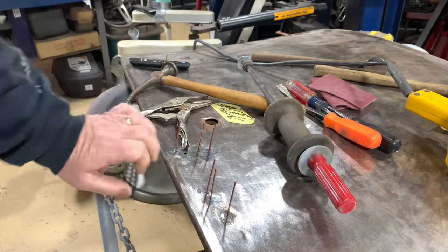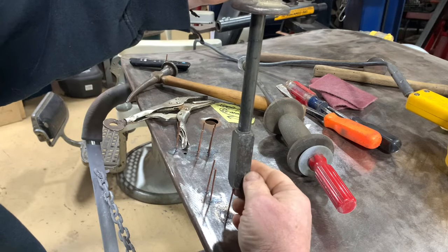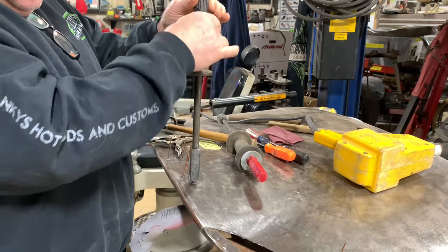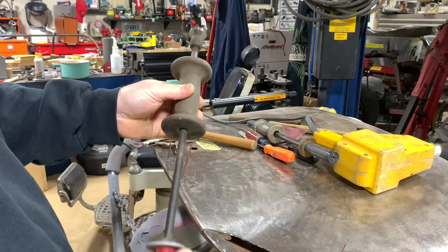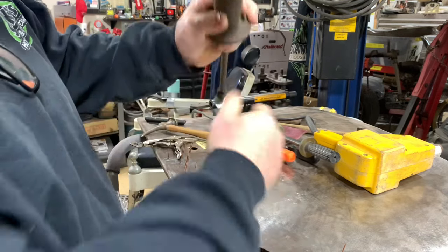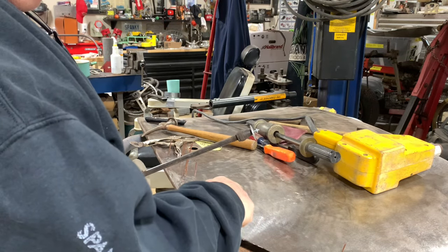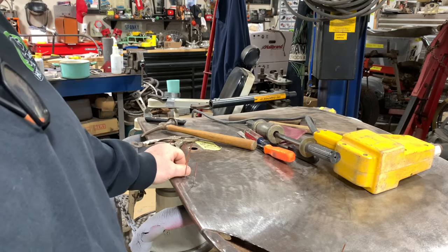If it's a serious dent, there's a little puller here — it slides on the stud just like that, and then you pull the handle to pull it out. Now these dents weren't big enough to need that. The old school way was the same type of slide hammer, except instead of studs you'd have a sheet metal screw on the end that you'd insert into the metal and pull out. That leaves a hole everywhere the screw was — you weld the hole up, and when you weld it the shrinkage creates another indentation. So this stud method is the new school way, and there's even newer stuff out there.